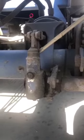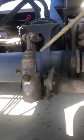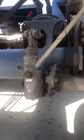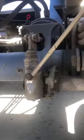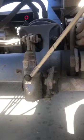With my brakes released, I should have no more than 2 inches of play while pulling on the slack adjuster. If I were to have more than 2 inches of play, I would get a 9/16 wrench to my adjusting bolt, do a full turn clockwise until it stops, and a quarter turn counterclockwise. If I adjust one brake chamber, I'll adjust the rest so I can brake evenly.